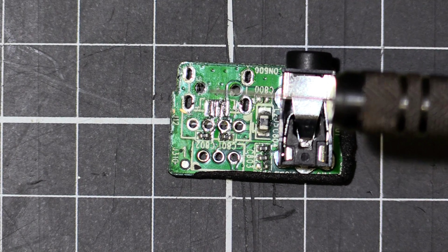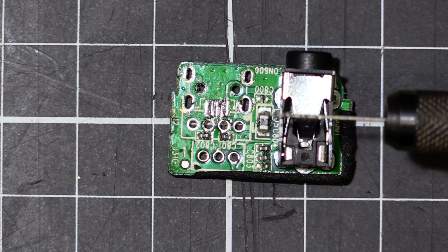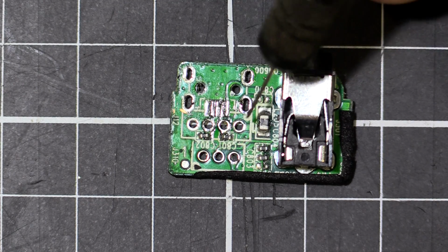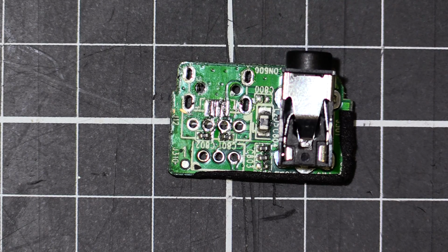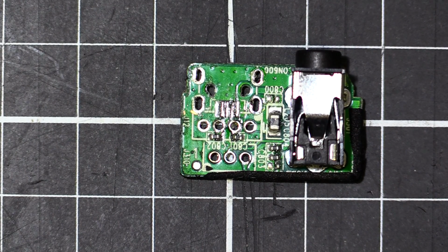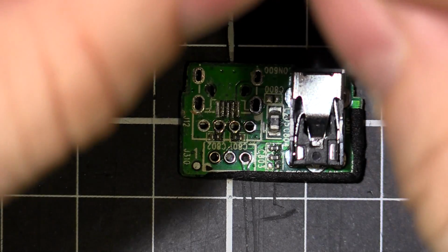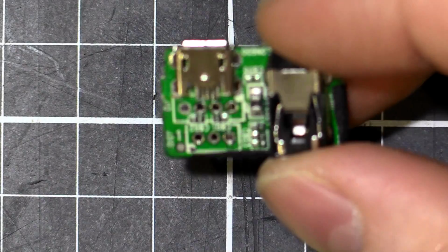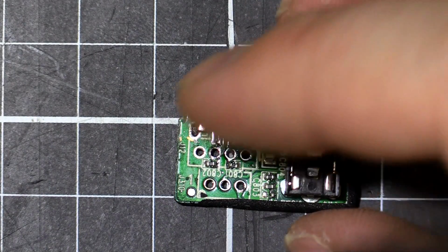That's the size drill bit we're going to be using, 0.6mm. So my fat head's probably going to get in the way, but I'm going to give it an attempt at drilling 2 new holes so we can fit our new plug. Okay, so you might be able to see the elongated holes there. Now we'll see if our plug, our socket, will go in. Perfect.